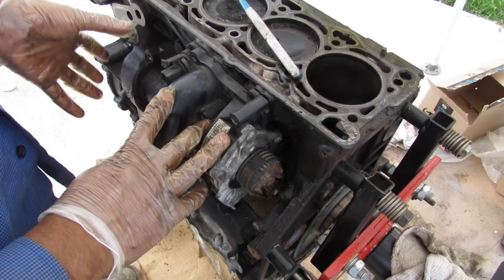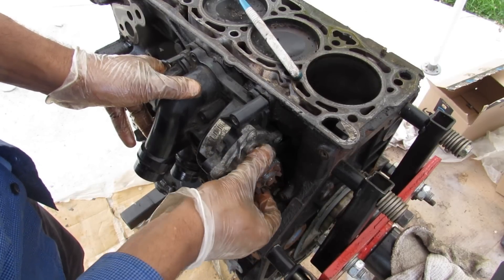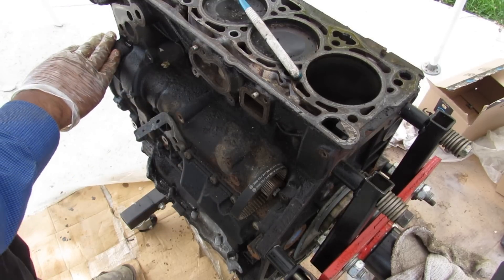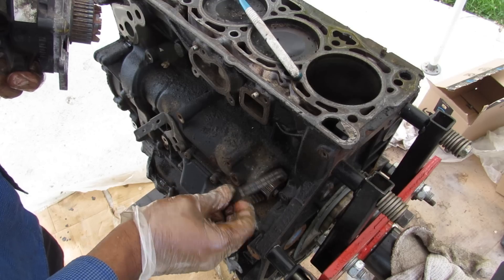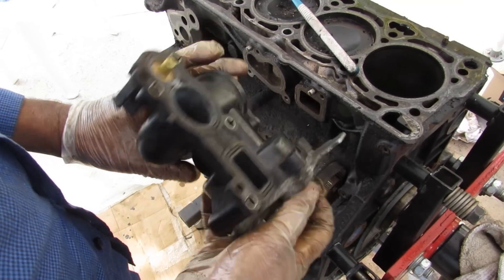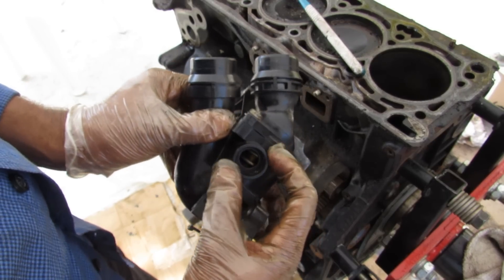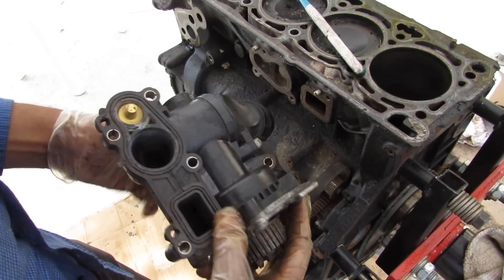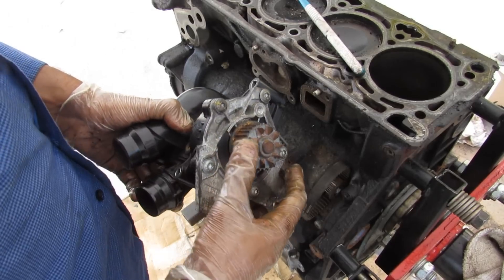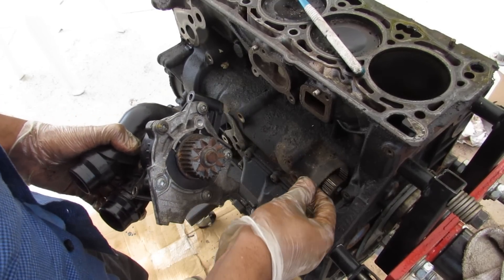The oil cooler on this side shares coolant into the water pump assembly. Over here we have the water pump's belt — pulling off the water pump, you can see it's driven off the balance shaft inside the block, which is driven off the timing chain. A small gear drives this little rubber belt that feeds the water pump. These water pumps are a huge sore spot on these Volkswagen engines because the plastic housing causes them to fail and leak. Same with the thermostat. Getting at the water pump is difficult because it's under the intake manifold, requiring removal of hoses, wires, and vacuum lines. When replacing it, you should also replace the rubber drive belt.